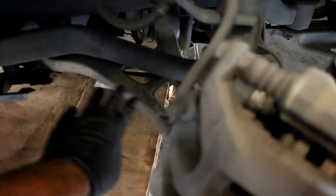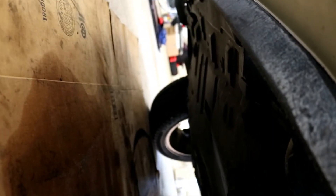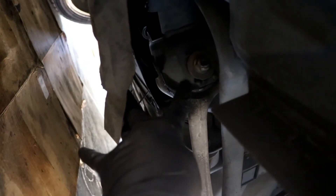This is the lower control arm here — it's pretty straightforward to get to. You might have to use a few extensions to reach the bolts, but you will need to jack up the car and put it on jack stands. You'll also need to take out the lower splash shield underneath the car. It's held on by various 10-millimeter bolts and a couple of clips. You'll need a 17-millimeter wrench and socket, a 19-millimeter wrench and socket, and a 21-millimeter.